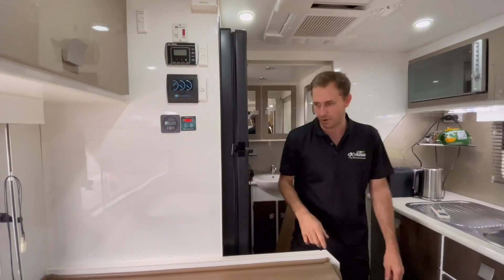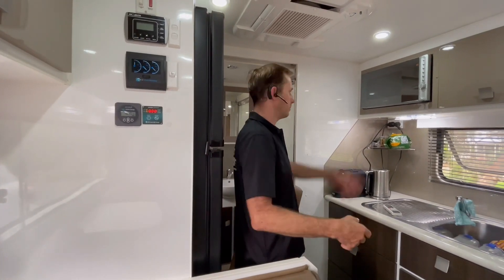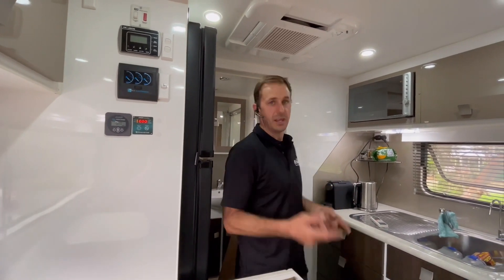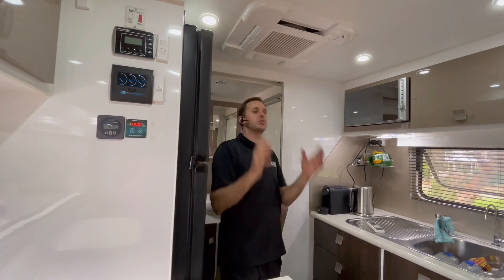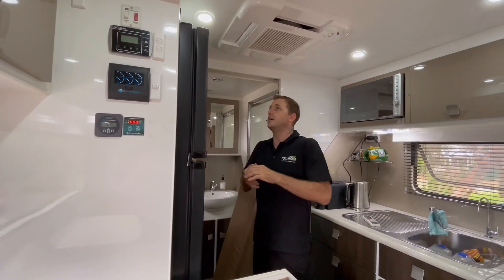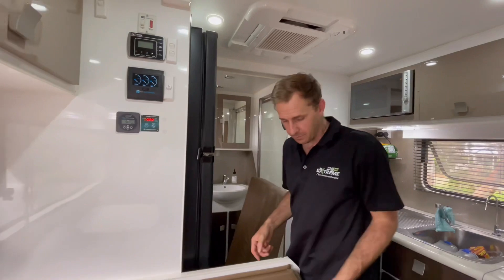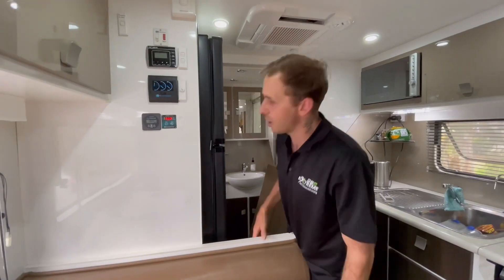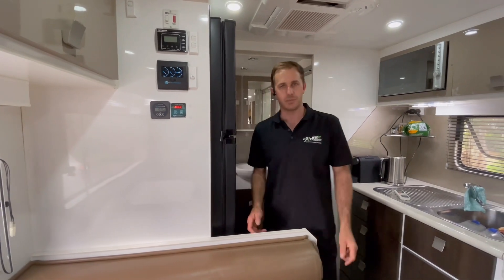Hair straighteners are like 300 watts — don't even worry about them. It's your hair dryers, your kettles, your coffee machines, your microwaves — these things use heaps of energy, but we're only running them for a few minutes so it doesn't matter. What matters is the air conditioners — things you're running for hours on end. This is where it's crucial to monitor your system and make sure it's done right. Yes, you've got 1,000 watts of solar, but it's not infinite — you still have to manage your power. But this is a monster setup: 1,000 watts, massive Enerdrive inverter, two split solar controllers, DC charging from the vehicle. These guys can even run the air conditioner while driving if they want — they've got that much power coming in, and they'll have a nice cold van when they rock up.